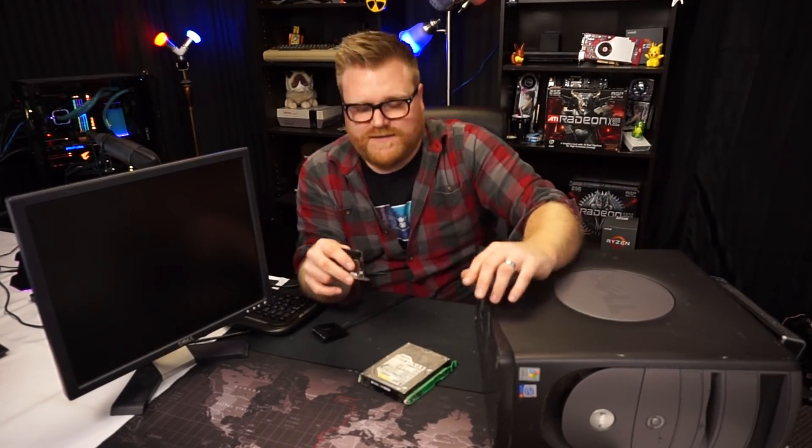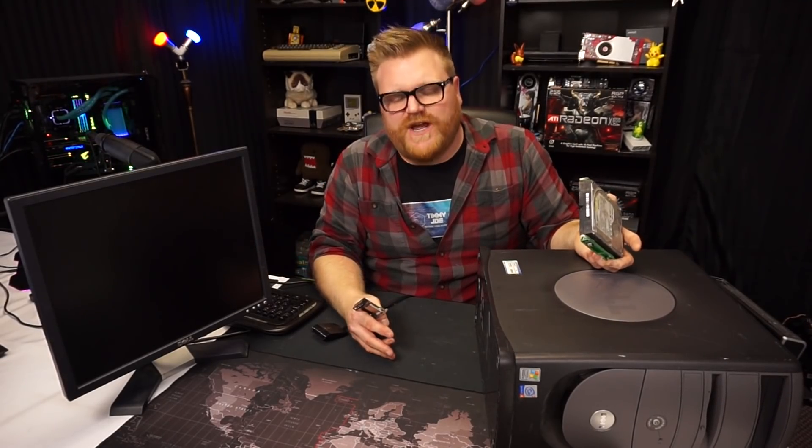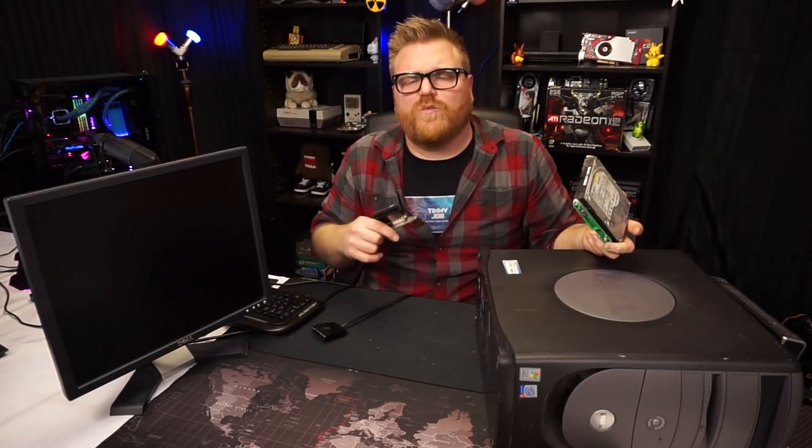So I've gone through the painful process of installing Windows 7, which this machine doesn't really like. It's a P4 — we're basically first generation. This is a Dell Dimension 8300. It has onboard SATA, but it's like SATA Gen 1. We can explore that later. I've installed Windows 7, installed Chrome, and turned the Windows Update service off so we won't have any interference from that. I also installed the Sound Blaster driver because the original onboard audio I couldn't get to work with Windows 7.